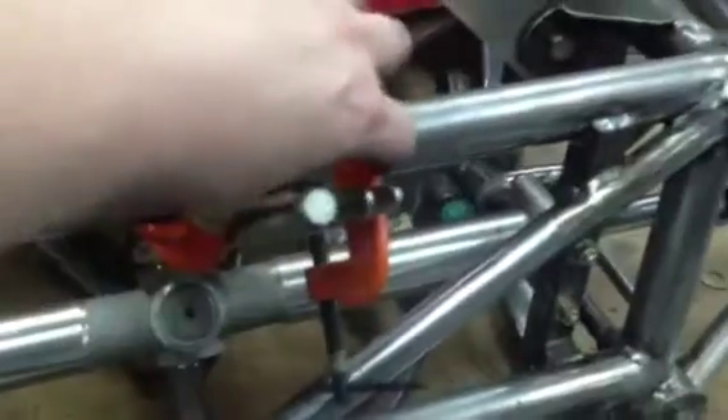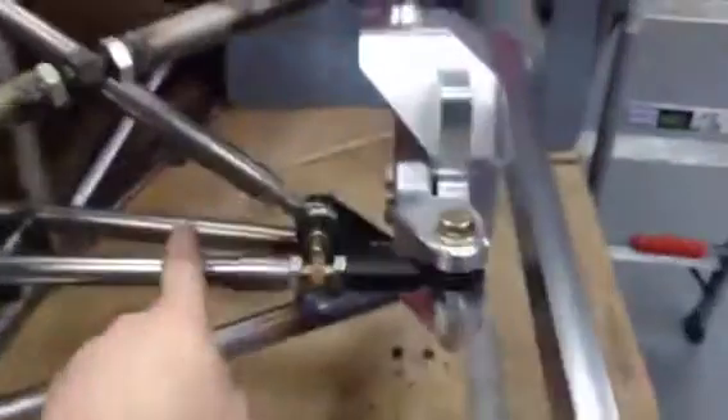While you're doing this adjustment up and down, you need to lock the steering rack — a pair of mole grips on the rack and then a G-clamp to stop the thing from moving. So I can waggle the rack around and it won't actually move out of position. I did one side first — the 339 measurement — and it worked so well, I thought, let's try it on this side. 339 also worked perfectly well, and that's a 339 measurement with a ruler between those two points on the bench before I put it on.